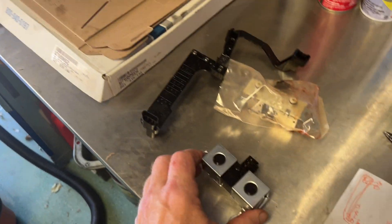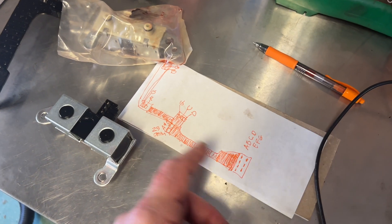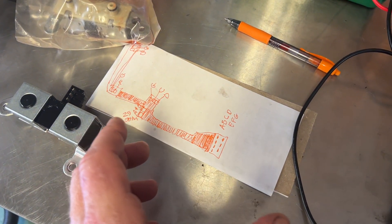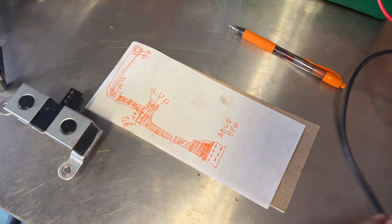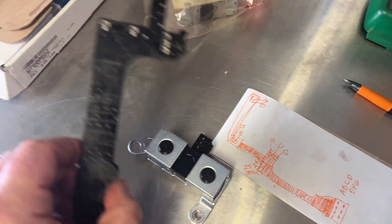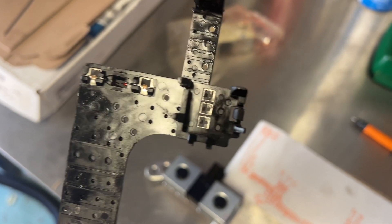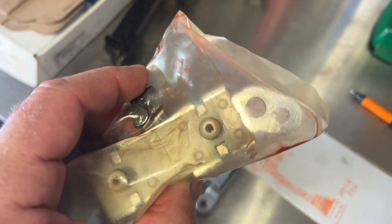I bought it with the kit — you'll see right there is the overhaul kit for the 4R70W. The first thing I did was make sure I had continuity. Sometimes these pins actually spread out and they don't make good contact. So I took the old solenoid I knew was good and checked continuity across the pins.